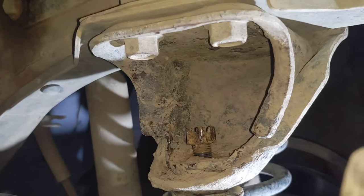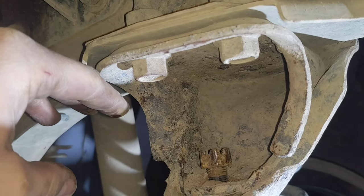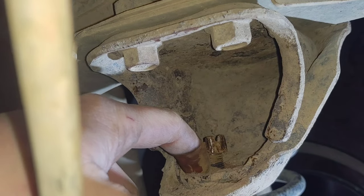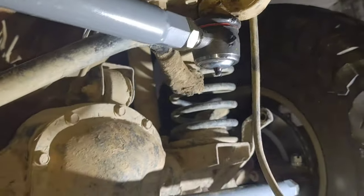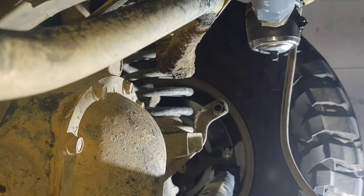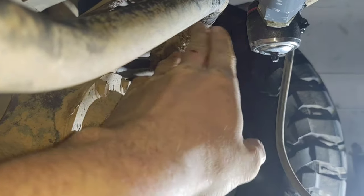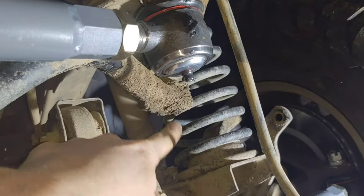The first bolt - I was gonna get the cotter pin out but I couldn't get it out. I backed it out and when I moved it the nut kept spinning even with the cotter pin and it just kind of sheared it off, so I just went with it. I also figured out that it's already loose. I'm gonna ream it out anyway. I really don't think I'll be able to use this bracket - I think I'll have to make one and move it forward, because if I have a straight bar this end will end up angled, but the axle would probably hit it. So I'll scoot it so the tie rod is more parallel and just enough out of the way to clear when it's straight.